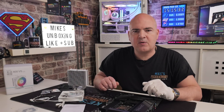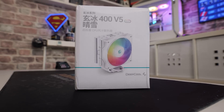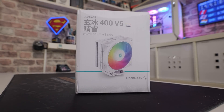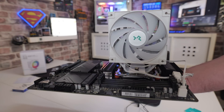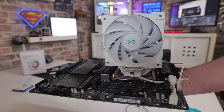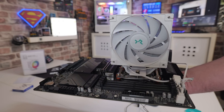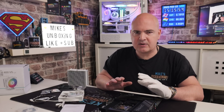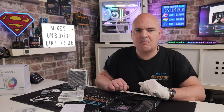Hi, this is Mike from Mike's Unboxing Reviews and How To, and on today's video I'm going to show you how to install the Deepcool AG400, otherwise known as the 400v5, onto an AM5 platform. This is going to be the same for AM4 or AM5 — the AM4 backplate is slightly different, so you'll want to have your motherboard lay down on a flat surface. With the new AM5 models, the backplate is pretty much securely attached so it shouldn't fall off.